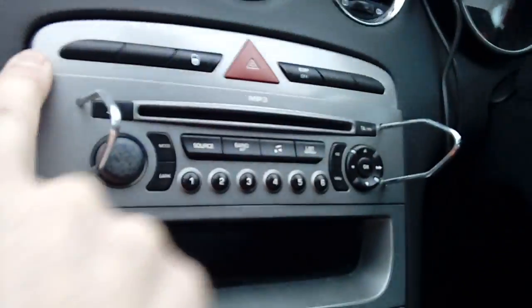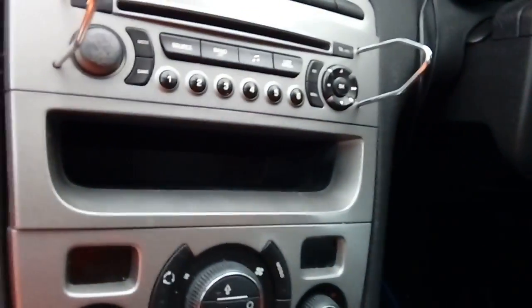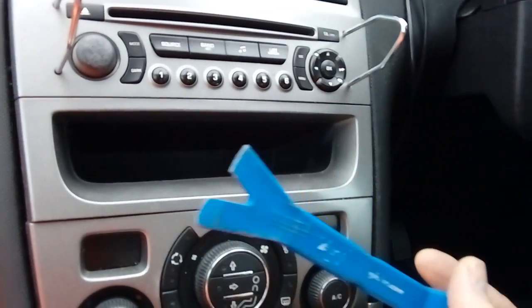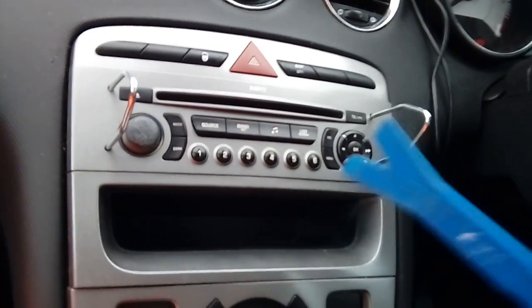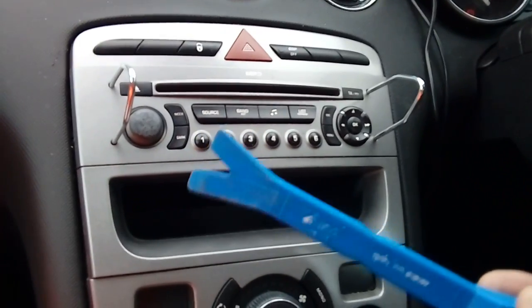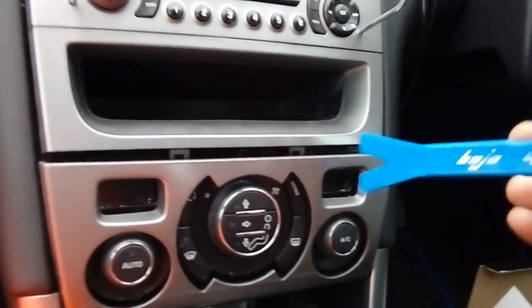Literally spread the keys and then pull, and the radio will come out. When you've moved it just a little bit so it's just released, don't tug it because it's actually clipped in below here as well — you just want to release the mechanism. You're then going to need something called a bojo tool or a plastic scraper. Don't use a screwdriver because you will damage all the plastic surfaces. Make sure you get a plastic one — they're like a pound, well worth it.